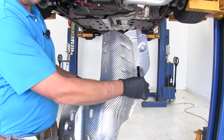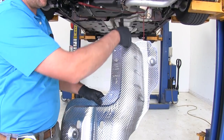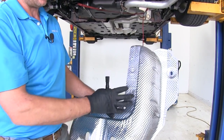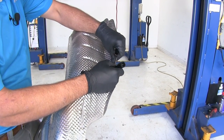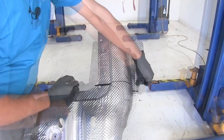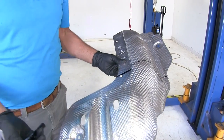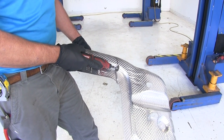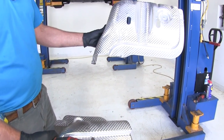In the instructions it is going to tell us to measure down 13 inches, which puts us about right above this hole, and then to measure in 5 inches and cut. But that is a really tough cut to make and you might risk cutting your fingers. So what we are going to do is cut straight across at 13 inches — we are not losing any protection with that. The texture of the heat shield itself has little dimples that create a pretty straight line, so we will just go right across those and come up just above that connection point. You can use aviation shears or a cut-off wheel, whatever you have got handy. Now we can set this portion aside and get the other portion reinstalled.